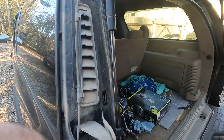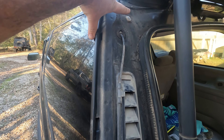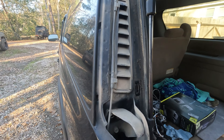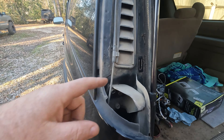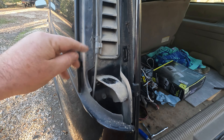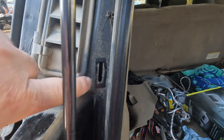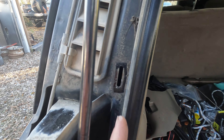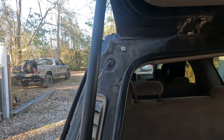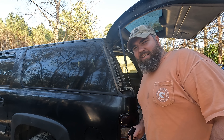The little flapper dudes — when you shut the door they let the pressure out of the cab. You get your one screw up here and then these kind of just fit behind your window. There's really no reason to pry here. I'd never taken these off before, but here's where your other clip goes in. That's what you stick the screwdriver up and pry out. I'm going to clean this up real quick and then pop on the Escalade D-pillar cover and give you a left-to-right comparison.